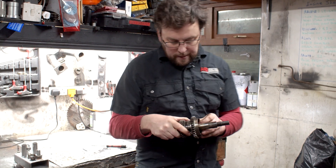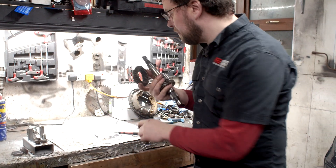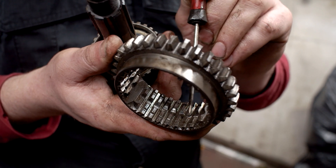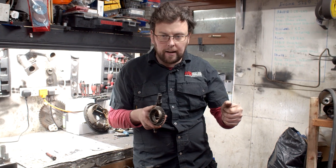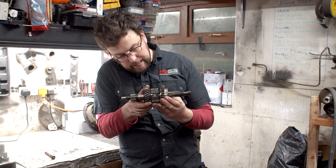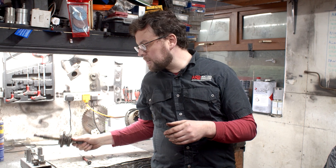There's one last thing that goes on in a synchromesh and that is what we call the detent. You can see there's a hole drilled in here — inside that will be a spring and a ball bearing — and it is matching up with a groove that is inside here. There's a groove machined all the way around the inside of this gear, and that groove is designed so that when we go to try and select gear the ball bearing has to come up and over and out, and that gives you that detent sensation — that locking into gear, coming out of gear, locking into the next gear. What actually keeps them together once gear is selected is not that detent; it is a small amount of angle that is ground into the dog teeth, and that angle basically makes them want to drive together as opposed to slipping out. That would also be in a dog engagement gear kit.